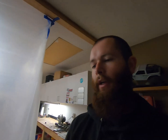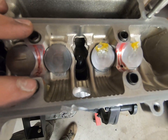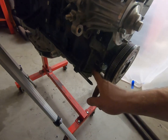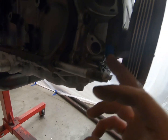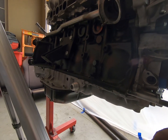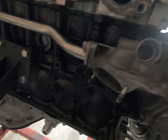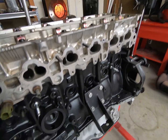I'm actually going to end the video right there. I forgot that I actually have to weld in the cam sensor. This is an NA head, and on the twin turbos they have a cam sensor that sits right here. On the NA head they actually have a distributor, so I went ahead and added that. I got the twin turbo oil pump which has the crank sensor provision. So this essentially will be a GTE setup minus the oil squirters and the oil channel that feeds the turbo on the turbo block. I didn't drill that on the non-turbo block so I'll get my oil elsewhere. That's all I'm going to get today — hopefully you enjoyed. We'll see you.